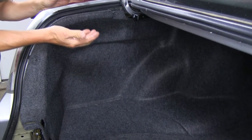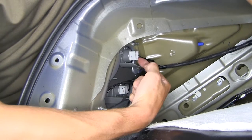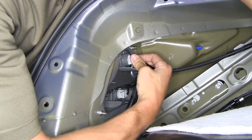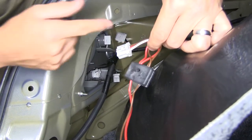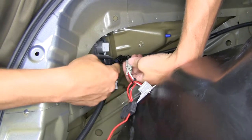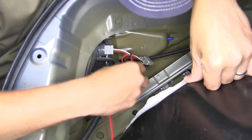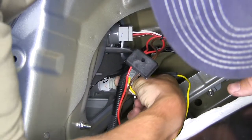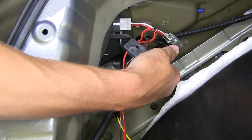You'll want to be sure to save those fasteners — we'll be reusing them when we put everything back together. With everything pulled out of the way on the driver's side, let's go ahead and point out the two connectors we're going to be working with and unplug them. There's a little button you just have to push down to pull that out. Now grab the red, brown, and white connectors from our T-connector and match plug to plug. Push it on until it clips together, then take the corresponding end and plug it in. Take the yellow and white wire and do the same thing. The red and brown wire tap into our running light circuit, and the yellow wire taps into our turn signal on the driver's side.